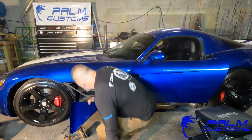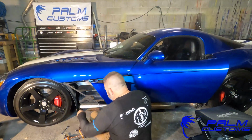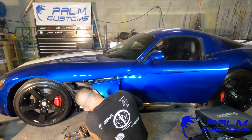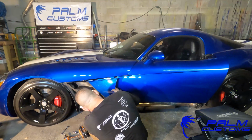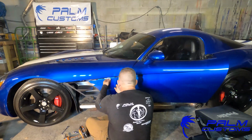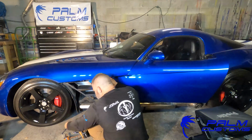That looked good. So I went ahead and grabbed the panel. And now we're going to reinstall that panel. Now what you want to do is slide that panel onto the new fin. And again, it's a locking piece. So it's got 3 parts that lock into it. Again, no bolts, no screws. It's just going to lock in there. And then you're going to put it up against, and you're going to use the T25. You're going to put those 3 T25 screws back in.